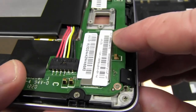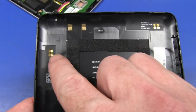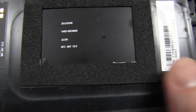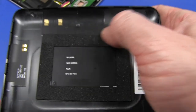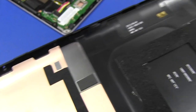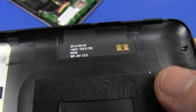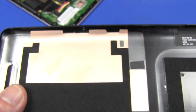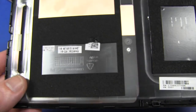If you take a look around the board here, you can see these little spring contacts directly on the PCB. These are for the three antennas on the back of the case — three pairs of mating contacts. Here's the near-field NFC antenna version 2.0, you can see the contacts and traces. And there's your GPS antenna version 2.0 as well. Over here we get the Wi-Fi antenna version 3.0 — all integrated into the back of the case. We've also got more copper shielding on the back of the case.